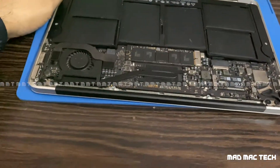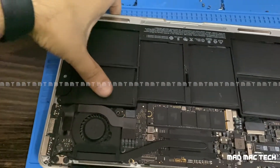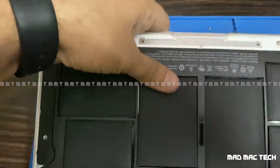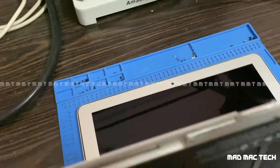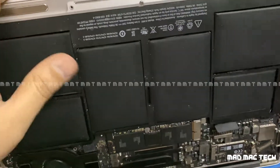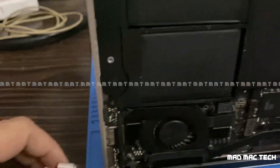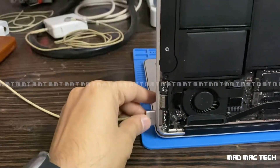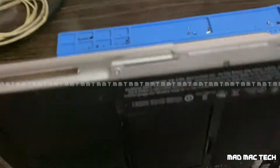The MacBook assembly is done — we have assembled it completely. Now we'll open it and connect the power. This particular battery has bulged, so connecting the battery it's not working on battery power. I have disconnected the battery and I'm connecting it to the power adapter. Let's see if we have a nice orange light and fan spin.